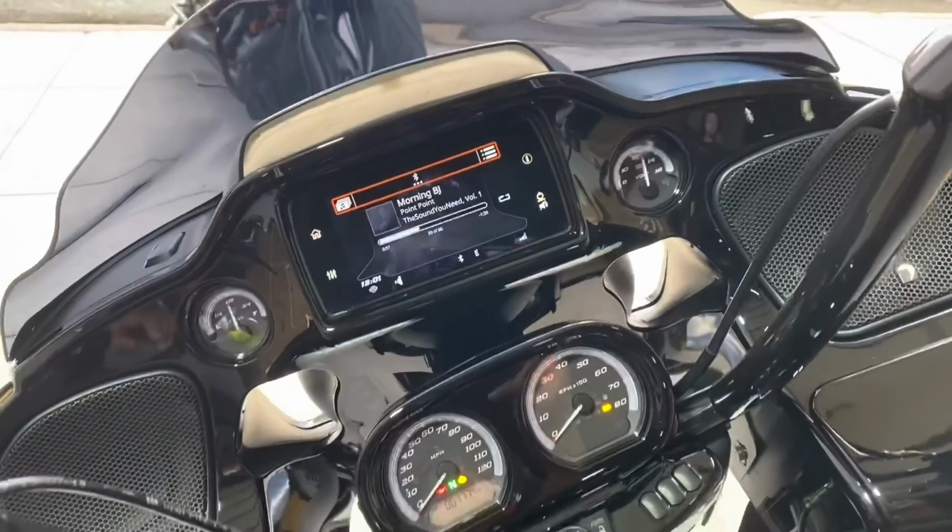Okay, this was not a wiring rescue. We kept the same amplifiers. We added a DSP, and we swapped out the Diamond Audio mid-range 8s for some Hertz mid-bass 8s. We reconfigured the way the amplifier was wired. Before, they had one 800.4 running the front, one 800.4 running the lids and the 8s. It was not enough power for the 8s.